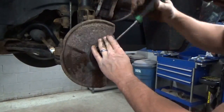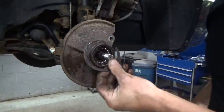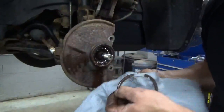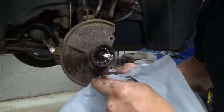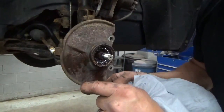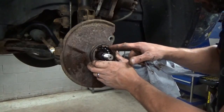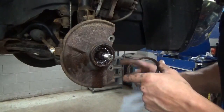They do make a special pair of pliers for this - I made mention of it in the Toyota video, which uses a very similar snap ring. In our situation where it seized up halfway around, pliers wouldn't be any good. Going back together they would be, because this snap ring is still in good condition and the little ears are still on it. In that Toyota video the ears got broke off - but you can still get these out if they break off. Just use your air hammer with the chisel bit, kind of cut a groove in it, hook onto it, and essentially use the same method but make your own groove.